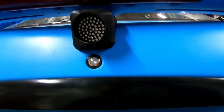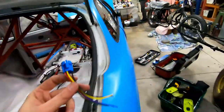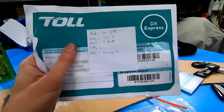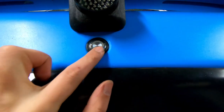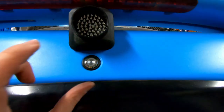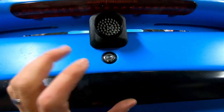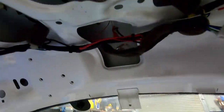Pop it through the hole and then I've made a washer for the back, and then we've got the nut that comes with the switch. Sweet — so there's our switch in. We'll have a look at the outside. Now that's nice. So I've also got a wiring loom and because I plan ahead I've written down what color wire does what. Cool little thing about this switch — it's got a little red ring around it. You can get it in different colors but I got red. Because the back of the car lights are red, I'm gonna wire that in so when you turn on the lights we'll have a little red ring so we can see it at night.